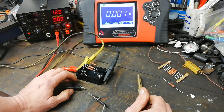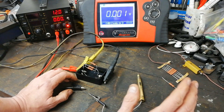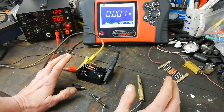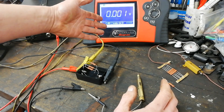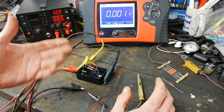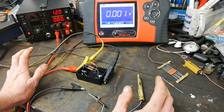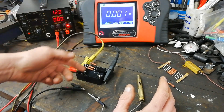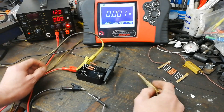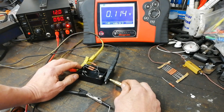This is for measuring very low current. If you have very low current flowing in a circuit, you can measure it with a voltmeter. There's a current measuring facility up to 10 amps from most voltmeters, but a scope measures in volts. So if you put that in a circuit, you can measure your current — it's going to measure in millivolts, but you just convert it based on your resistance values, and that will show up on your scope in millivolts.